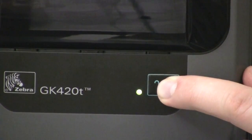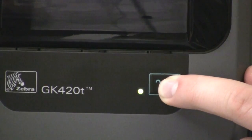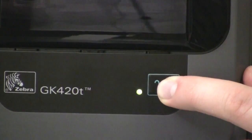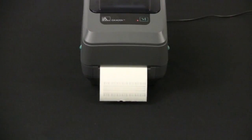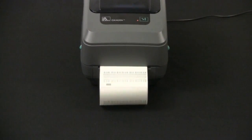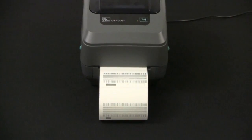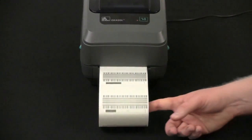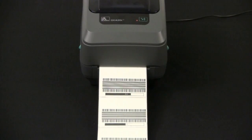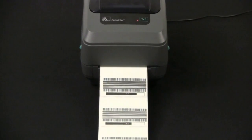A six flash sequence starts the print darkness or density adjustment. The printer will print a succession of barcode simulation patterns starting at the minimum darkness and ending at the printer's maximum darkness in increments of four using the ZPL darkness setting range values. Press the feed button once the pattern is clear and legible. Do not continue to increase the darkness setting, as barcode line widths may become distorted, reducing readability. Note that the printer driver and applications can override this setting.